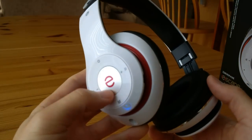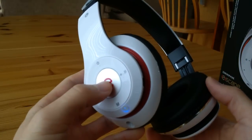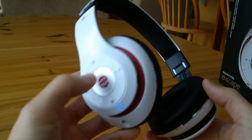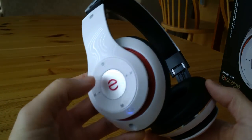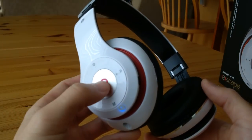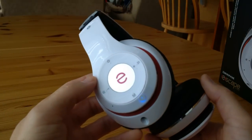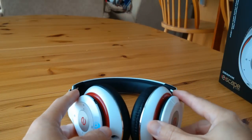And that's basically it. It's the holding of the large E button which starts the scanning and finding of the stations. I'm not sure when the stations are actually saved, but I went through the escape button first, let it run for a little bit, then stopped it — and the plus and minus buttons were then scrolling through the channels, which seemed to work. Hopefully that's helpful if you can't figure out how to use your FM mode.